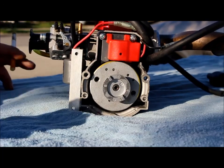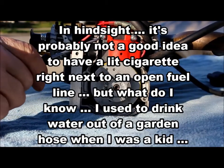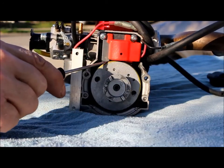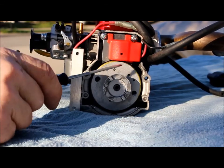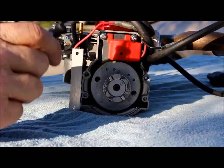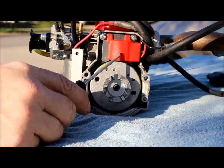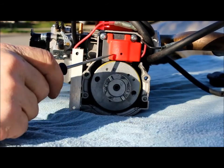And what happened was, when we did our little mischief at the pond, the gray coil was attached to this screw, wasn't tight enough, and then this coil dropped down and started dragging on the rotor. It scraped that a little bit, and he said when he was running it, it ran like it had a limiter on it. So if you ever run into that experience, check your clearance here.